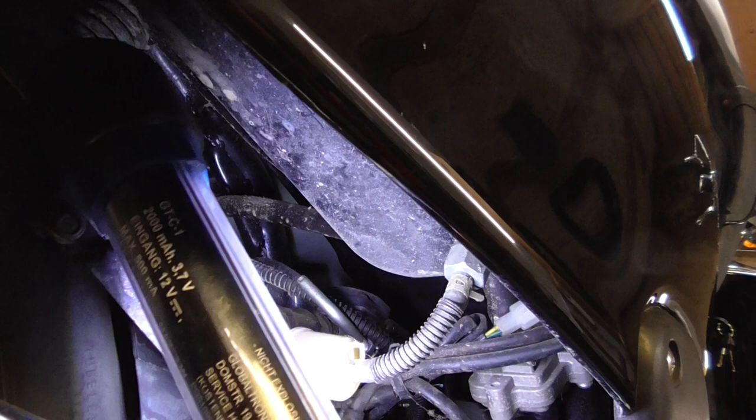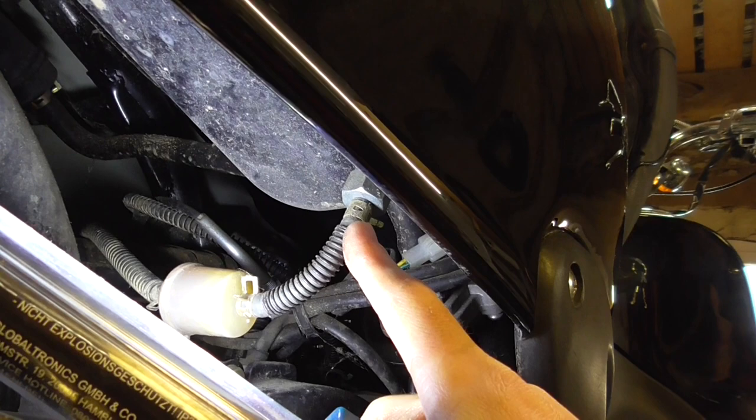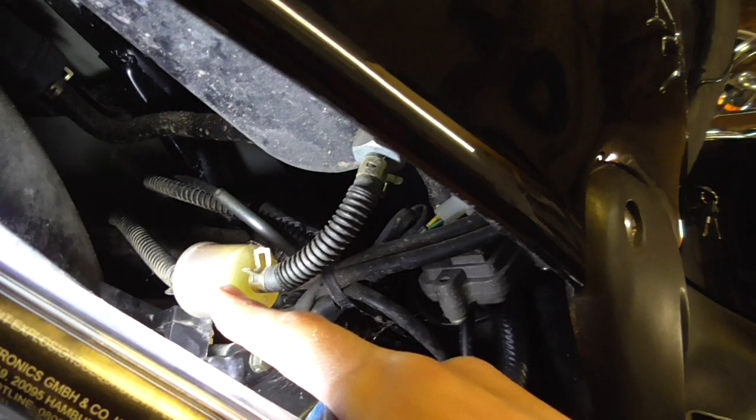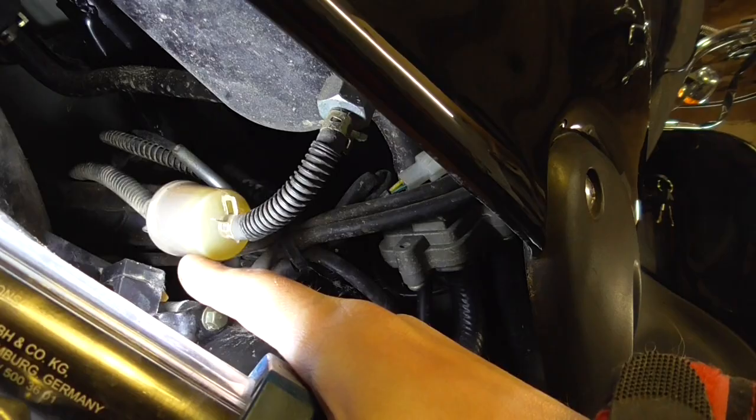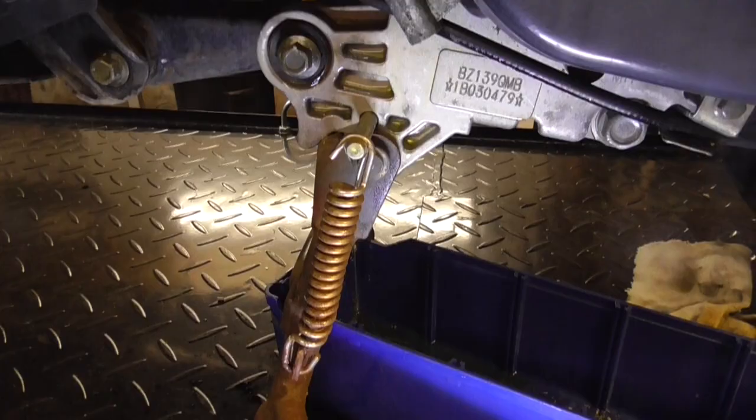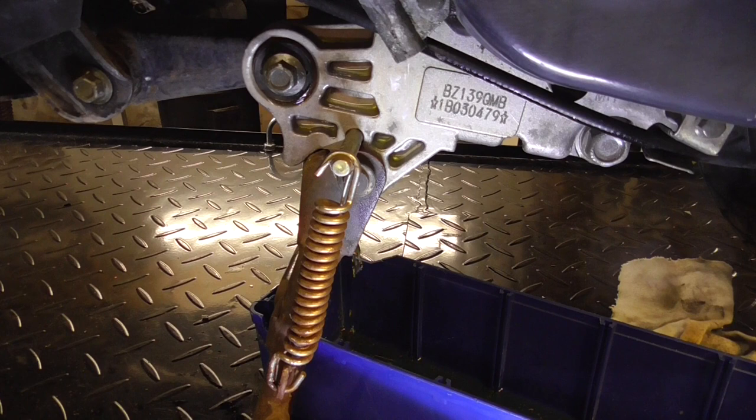Here's the fuel tank attached to a hose — there's no membrane switch or fuel switch at all. Maybe it's just this fuel filter that's clogged and not letting fuel through. But it looks good — it's filled with fuel. So we'll let out all the old fuel and see what's going on.